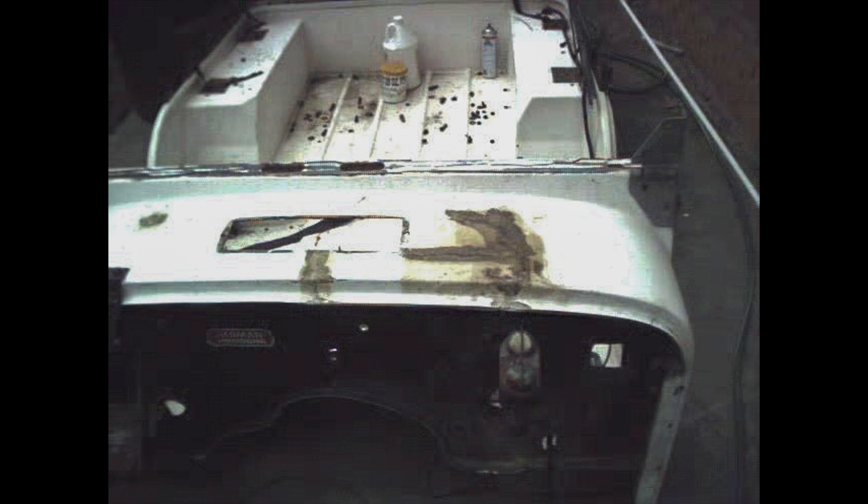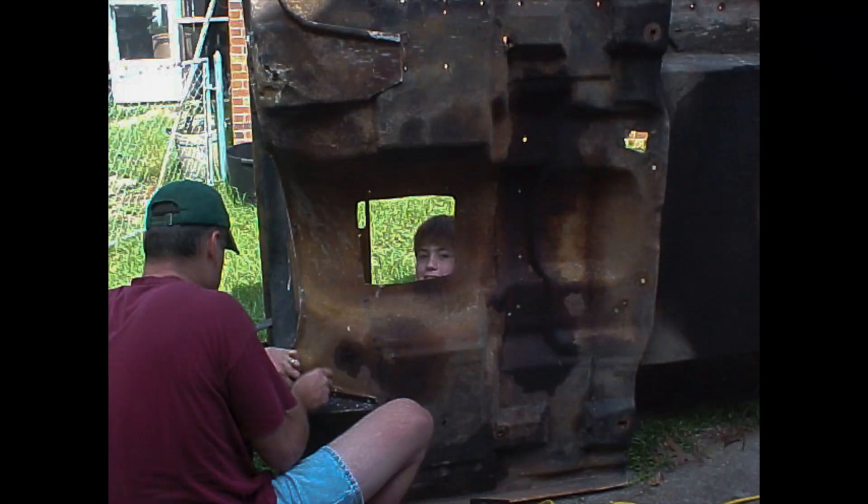As you can see, it had some cracks on the cowling. I did some fiberglass work — bought a fiberglass kit at an auto parts store, read the instructions, cleaned it up, sanded it down, and patched it myself. It took a while with multiple layers. I'm not a body person, but I had to do it myself because I didn't have the money. I then took the old tub apart and had to cut so much metal off because the mounting spots and bushings were rusted out — the nuts and bolts were all rusted and I had to cut a lot out with a cutting wheel.